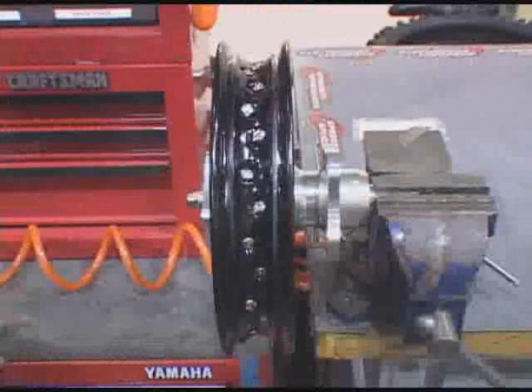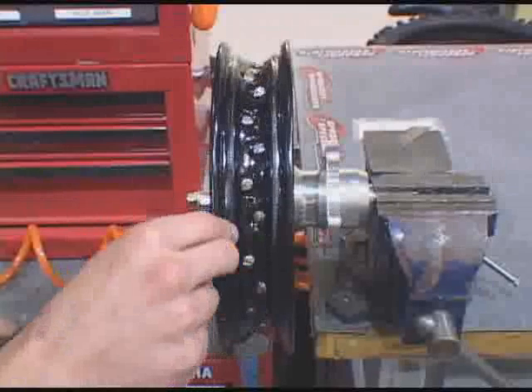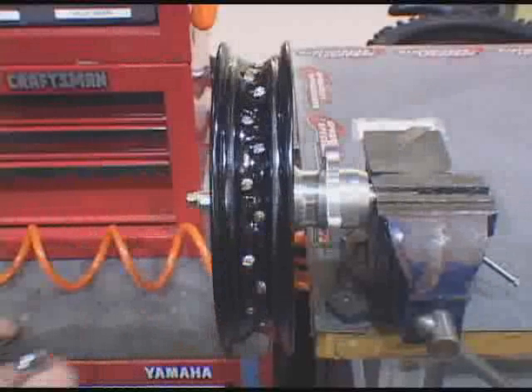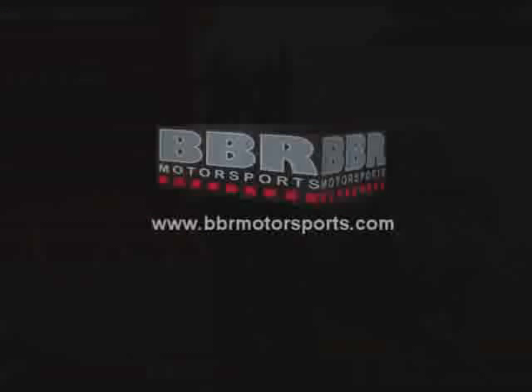Continue to true around the wheel until you have barely any side to side motion, then double check to make sure everything's tight, and then you're set to go. Put your tire on and you're ready to ride.